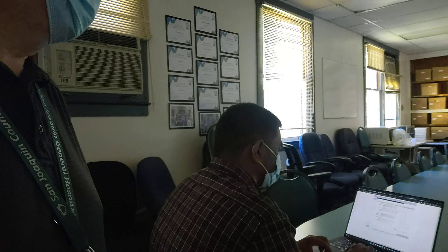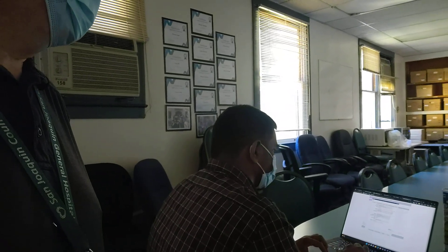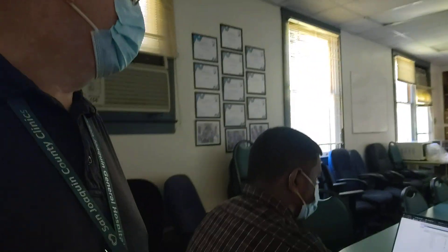In the location, we want it to be Benton Hall — go ahead and take the autocomplete. In the zone, it'll be the same: Benton Hall. Now let's go over to the top tabs, the WLAN assignment. That looks good. Check radio one — that looks good. And radio two — that looks good. Now let's go over to static configuration.